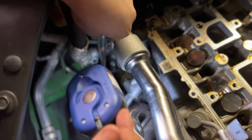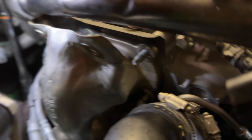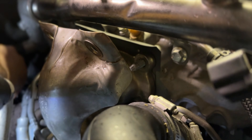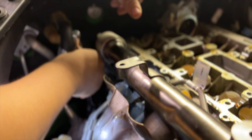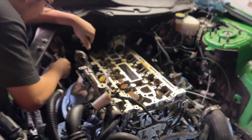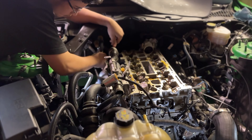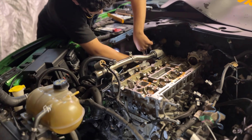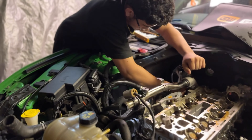We've got everything disconnected so far except for the down pipe, so Nate is in here trying to disconnect that. We were hoping we could lift it enough to slide it back, but there's not a whole lot of play around those studs. We'll have to loosen that to move it away. We disconnected everything else hoping we wouldn't have to start disconnecting oil lines for the turbo. We've never done anything like this to an EcoBoost — last time I did something like this, the engine was outside the vehicle.